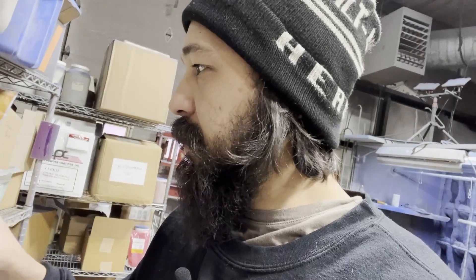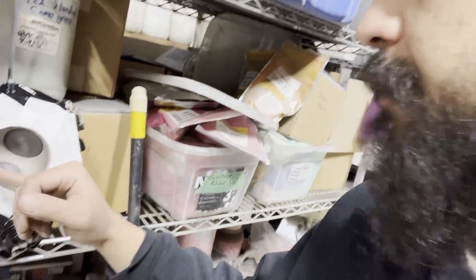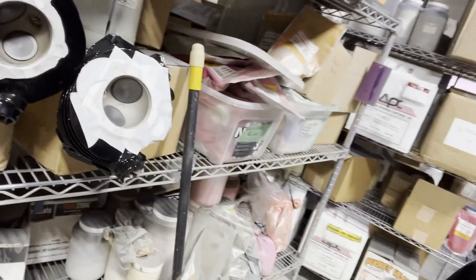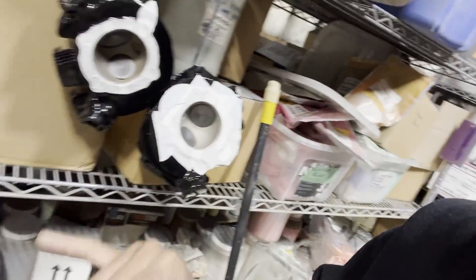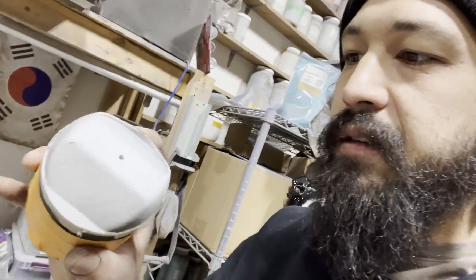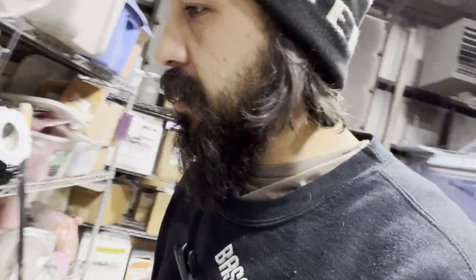I'm not building a show bike. It's just more efficient going this way. Why not have really nice shiny pretty parts before you start grinding and shooting metal all over the place and destroy the freshly coated, perfectly good-looking heads. But I got the chambers on these cleaned up. Everything's taped off along here so I shouldn't have any issue on the gasket sealing surface when these get mounted back on the cylinders. We are going to hit this with the piston coating as well as the crown coatings on here for high heat. Essentially, that should act like a mirror for heat and put all of the heat into the top of the combustion chamber.